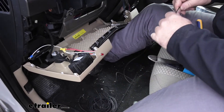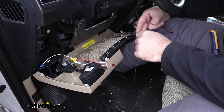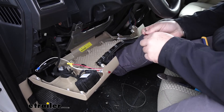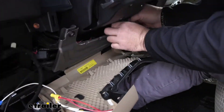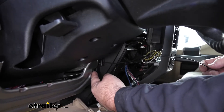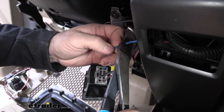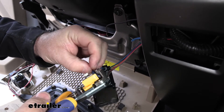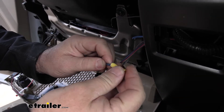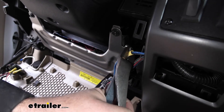For this I'm actually going to run it up through the dash and connect this to my blue wire first, then bring my extra wire on this side so I can judge how much I'm going to need and cut off any extra. I'll take this and go back behind this panel, reach up behind my dash, and push this black wire out through this hole where my brake controller would sit. I'll cut my brake controller wire and strip back both ends. Let's start with this side and add our butt connector — black wire goes on the other end of the blue wire, put it into our butt connector, and crimp it into place.